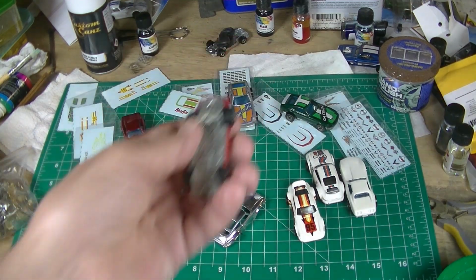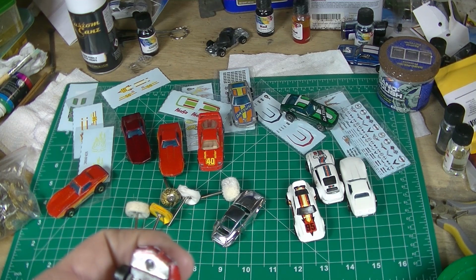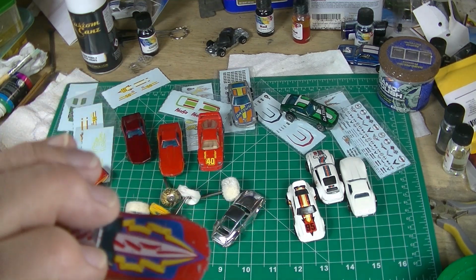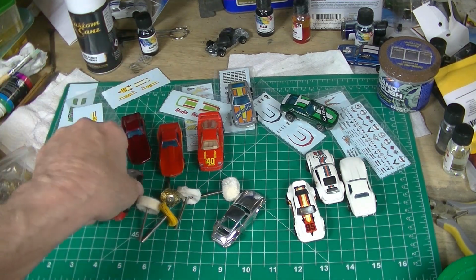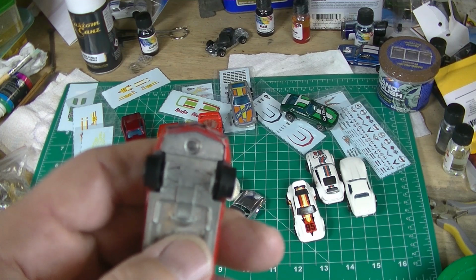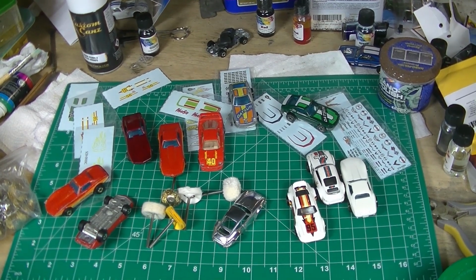That's going to be a pain. Now, you want to use a center punch, like I was told by Sean and a couple other guys. But then, how do you know you're not going to ding up the other side? So I've got a Dremel tool, Binford 5000. I use a little teeny round ball, about the same size, and I get a crater down there, and the drill bit goes right to the middle all by itself. I don't have to center punch it. I don't have to hurt the car, make any dents or anything.